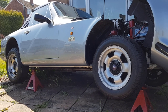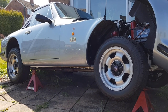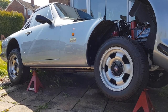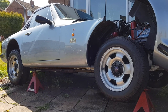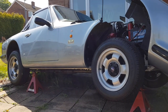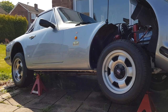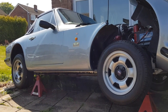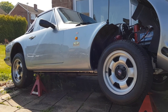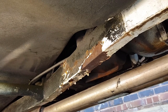Using the Land Rover part also means we can replace it quite easily if we need to at a later date, rather than trying to source an original TVR item. The only difficult part is the input pipe to the slave cylinder — it may be a slightly different thread, so we'll find that out once we've taken it off. Let's get started.